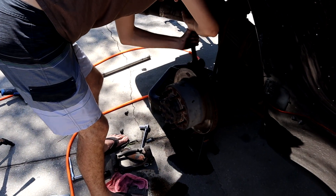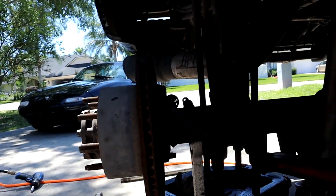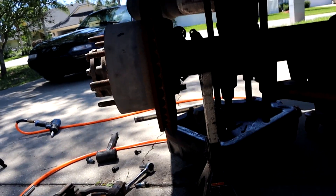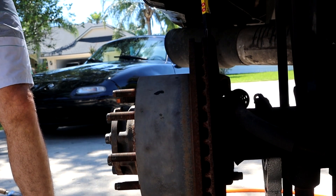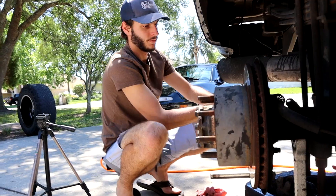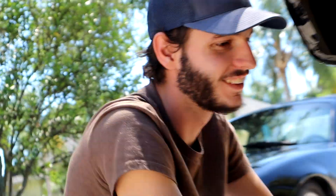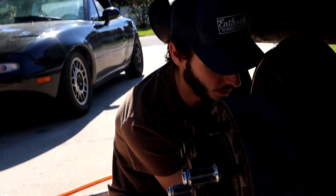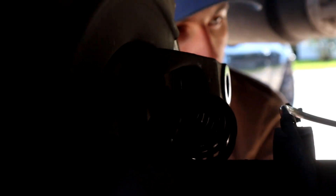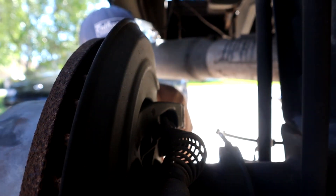That's not moving at all. This truck's not even that old — it's literally only nine years old. Be careful not to pop that rotor off onto your foot. It's just shaking the frame — that thing is stuck. We're going to change our pads regularly from now on and not ruin more rotors. We tried hitting it with the hammer but that wasn't working, so we're trying a trick from online: we've got these little holes that hold the brake caliper in, so we put a bolt through there and a nut on the other side, and as we tighten it, it pushes the rotor off.